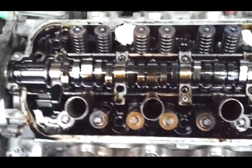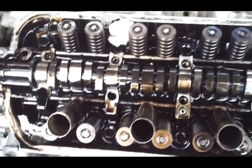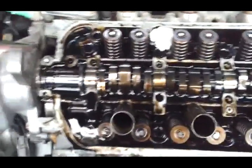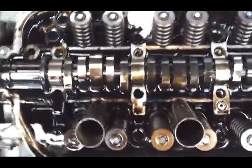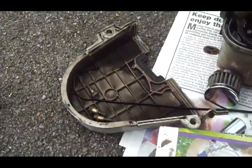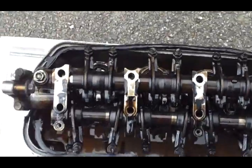This is a quick guide on how to replace your valve stem seals yourself without using any technical tools. You don't need a compressor, you don't even need a valve spring compressor for this job — it's quite simple. First you're going to strip the rocker cover off, your valve rockers, followers, and everything. The cam timing cover down there — take that off as well, and just take it all out. Keep it all together so you know where everything goes.